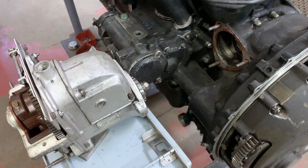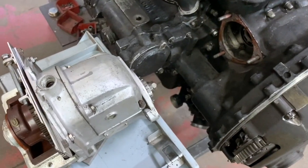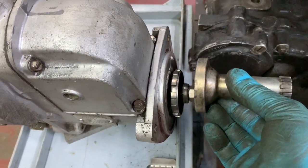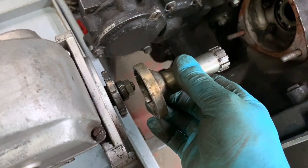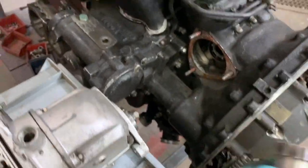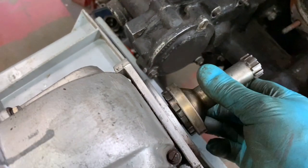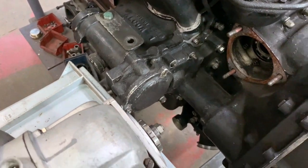I've got the magneto sitting in line with where it's going to go on the engine. The coupling shaft in this instance has 12 dogs on the back of it and 11 on the front — one goes into the engine and one goes over the magneto. So again it's a vernier shaft and it enables you to set the timing to a fraction of a degree. It's not a simple question of fitting the magneto to the engine and then turning the shaft like with the camshaft. You have to hold the mag, which is why a locking tool is useful. You basically have to fit this on, put it into the engine as a whole assembly, see if it fits — if it doesn't, take it back out, move it around one tooth, and keep doing that until it fits. And that's basically the timing done.